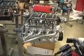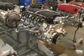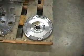That's another thing about the LS9 — it has a nine-bolt flywheel that bolts to the crank, where the earlier ones have six. Here's one of the flywheels laying here off the LS9, and we've got a company making us a flex plate now so we can run automatics behind it.